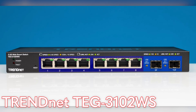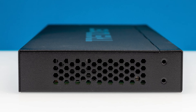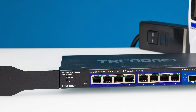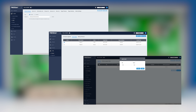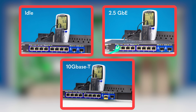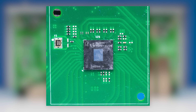If you want something that's a little bit higher end, we have that for you. This is a TRENDnet switch with the same eight 2.5 gig ports, two SFP Plus 10 gig ports, but you get other little features like rubber feet and rack ears. There's a slick management interface that you can use to manage the switch — actually one of the better management switches we've seen in this entire roundup. The performance is okay for an inexpensive Layer 2 switch, and the power consumption is slightly higher than the Giga Plus switch.